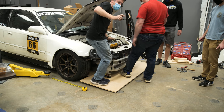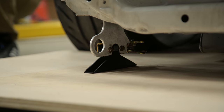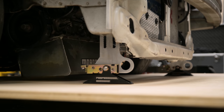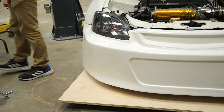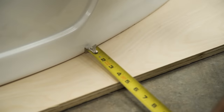We're going with a wood splitter. We generally recommend a half-inch, but we're going with three-quarter inch this time because it's more robust, stiffer, and that's what Ben's asking for — it'll also last longer because it's stronger. For the new class Ben's competing in, he's a little underweight, so that weight sitting low in front of the car is good for the center of gravity. The rules allow for about three inches of stick-out from the bumper — three inches extension from any point on that bumper.